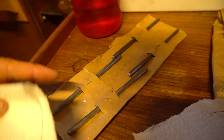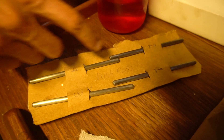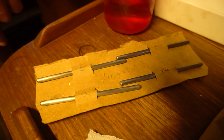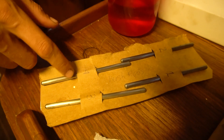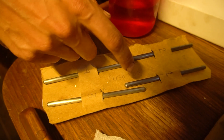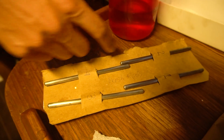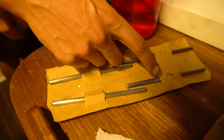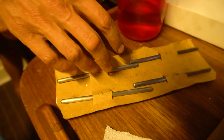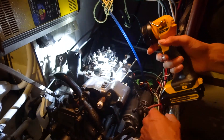I'm oiling absolutely everything that goes back in the engine. Now it's pushrod time. One thing to keep in mind when you're doing something like this: we wrote numbers one through four on the pushrods but didn't indicate which direction was number one — is number one the front or the back of the engine? From memory we're 98% sure number one was at the front, the pulley side, but it would have saved us a lot of grief if we'd written 'front' or 'back' on them like we did with every other component. Don't just number it — give yourself some indication of front or back.